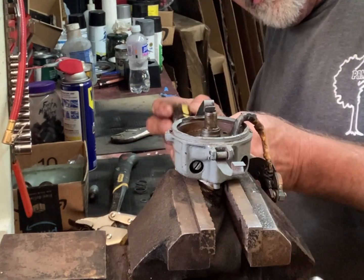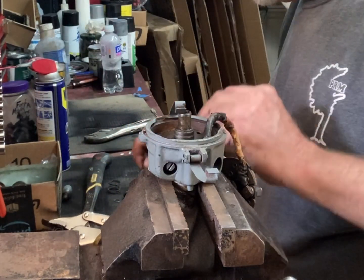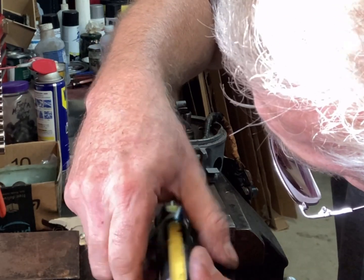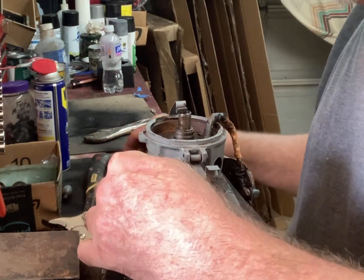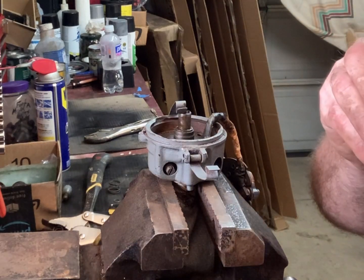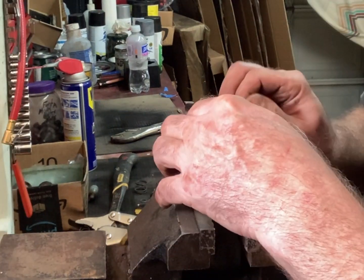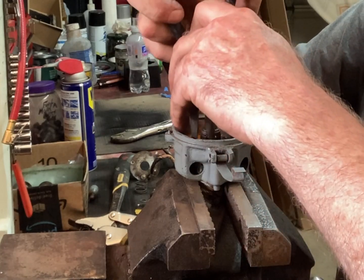I've got a condenser in there. Condenser pins are not attached anymore. Spider webs, but the little plate holding that on there that was maybe soldered, no longer soldered. Okay, that was the problem. I didn't realize there was still a condenser in there. Let me get this condenser screw out of there.